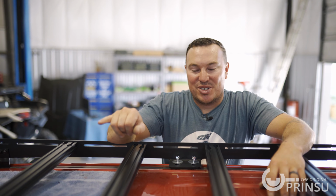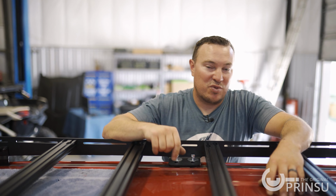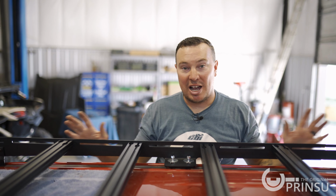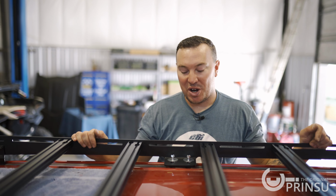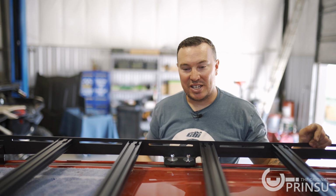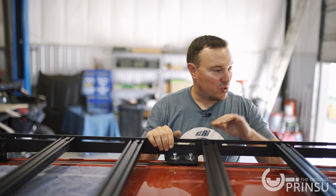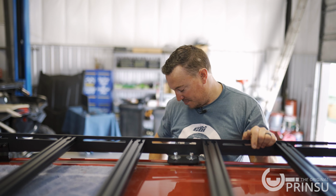All right, mounting feet are secured. Now we're gonna start tightening down our 4 mounting positions around the corners. Alignment is good. We got everything squared up the way we want it. Do not over tighten these. Don't use an impact. Use a ratchet and tighten them by hand, and we'll start going around and getting that done.